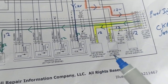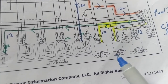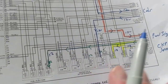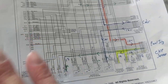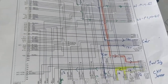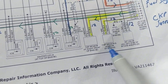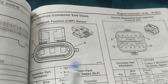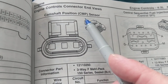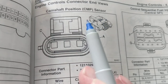Let's come back to this one here — we're not sure: is that camshaft sensor, or is this CKP or CMP? Let's go for CMP. We have three wires here. This example is for Honda and Asian cars; this manual is for GM. However, the cross-reference idea is the same. We come to this part which describes the connectors and try to figure out what CMP is. CMP is the camshaft position sensor — so it already helped me identify what CMP stands for.